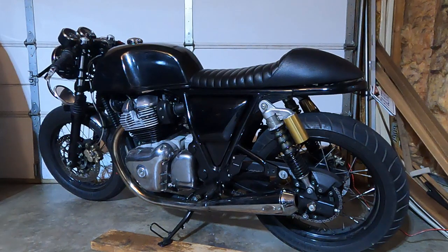So first gear became usable. And it wasn't like crazy torque, but it pulled longer and harder, if that makes sense. And then second gear took me all the way over 60 miles an hour. So I got my best 0 to 60 times with that 17-tooth front sprocket. The engine just needed to be geared that way.